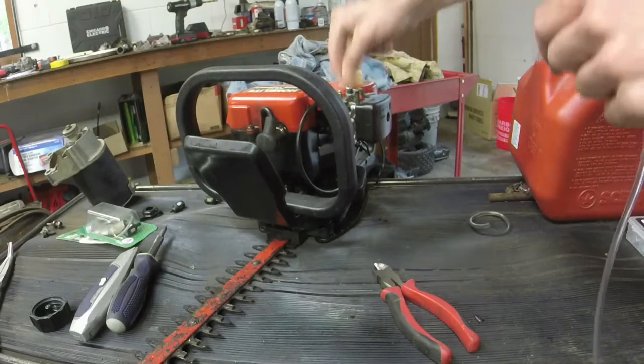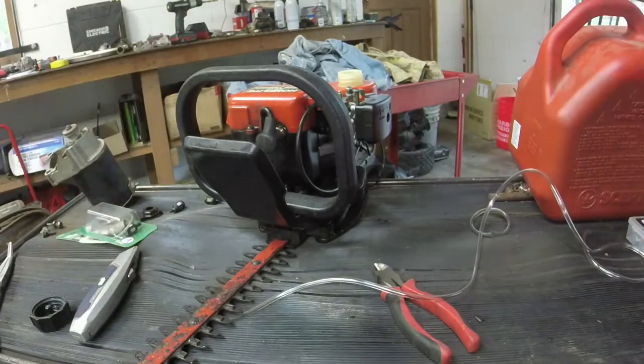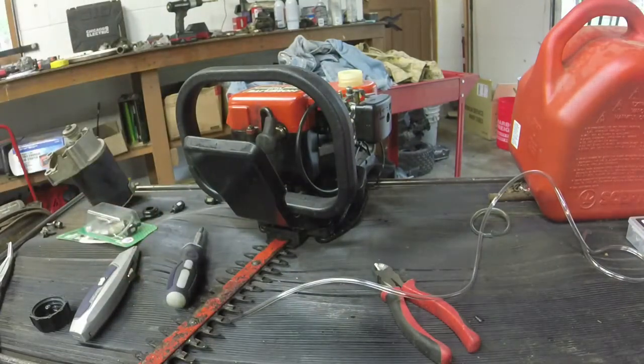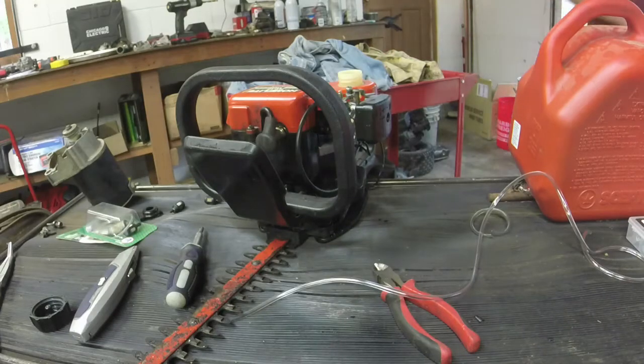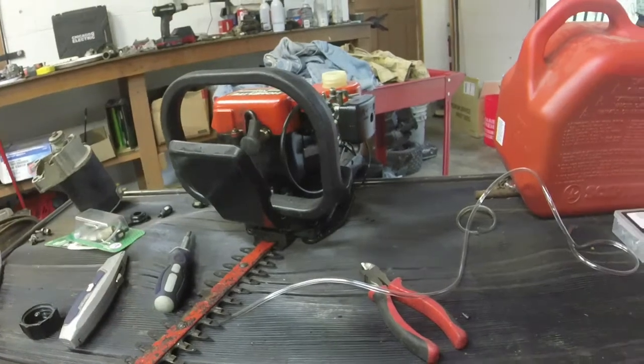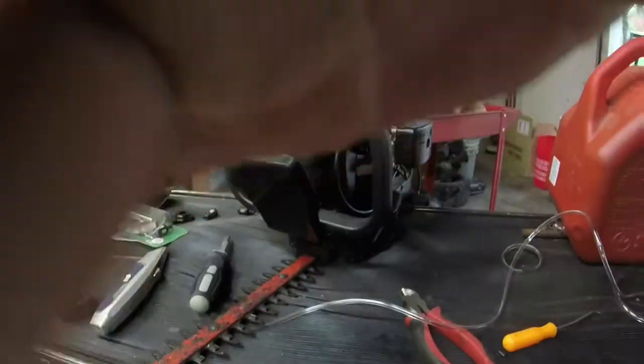because I'm going to run this through the inlet to the carburetor, which I really need to clean out the inlet port real quick. If I can get the tool, I'm just using this. I'm going to clean out the inlet port right here, because it's a little gummed up. I don't want to have any issues with trash getting sucked down in there, or old fuel line or whatever. So that's relatively clean. I don't really want to spray carb cleaner down there if I don't have to.